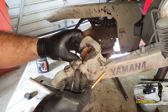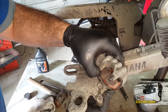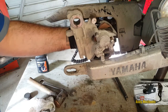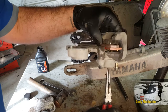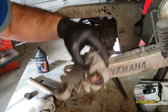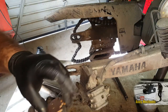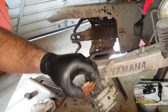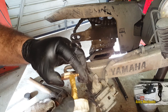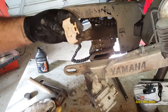It's important not to get the copper paste on the brake pad - that would be bad. A lot of car mechanics that are not particularly good tend to get a lot of oil and grease on the brake pads when they're fitting. So pad number two - this one goes in that way around, so it needs some copper paste on that end because that's the end that slides against the shoulder.